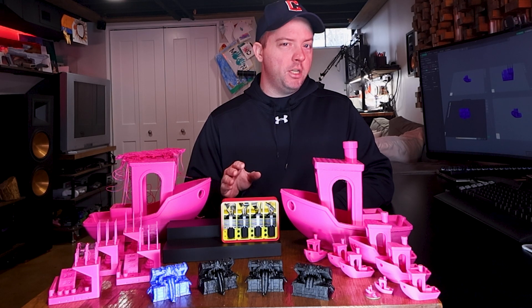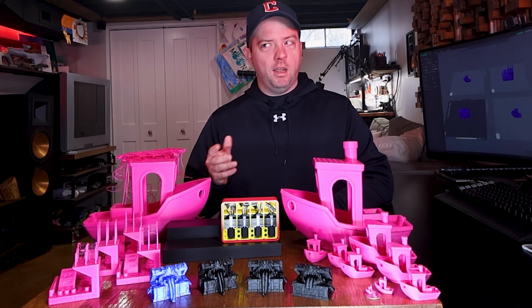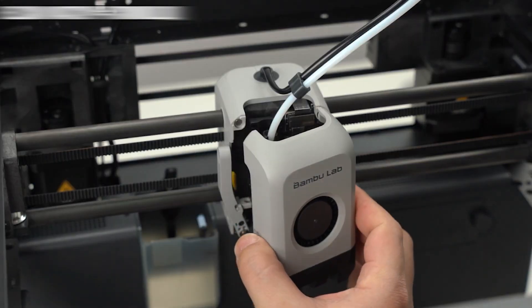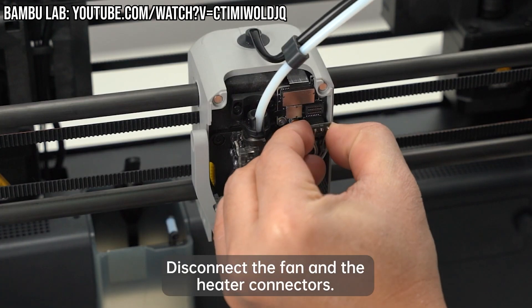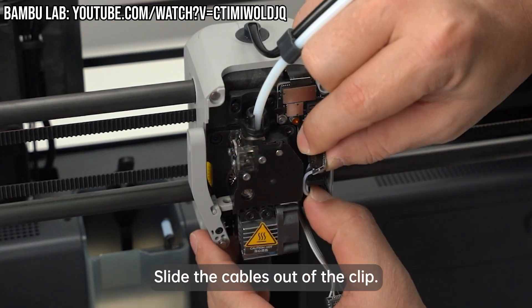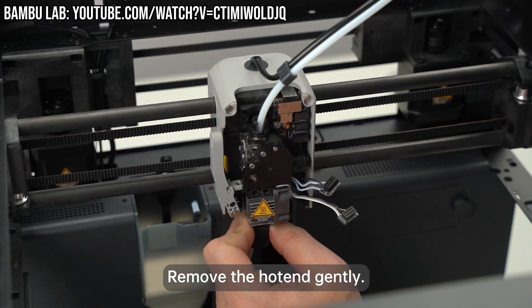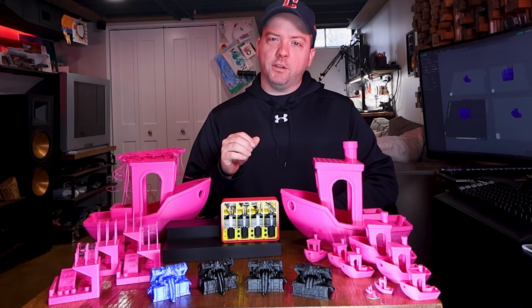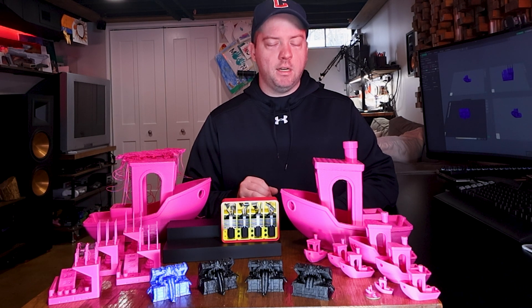I got awful footage of changing the nozzle on the P series, so I'm going to defer to the official Bambu video, which did this without the top cover — a good idea. Once again, heat the nozzle, retract the filament, and let it cool. The front fan cover is held on with magnets, so pull it off and carefully pull on the fan connection to completely remove it. Carefully remove the two remaining connections on the PCB. There are two screws requiring a small allen wrench holding the nozzle in place, then pull straight down to remove it. Reverse the process to install your new nozzle. If you don't seat the connections correctly, you'll get an error that the fan speed is abnormal because the nozzle fan connection wasn't fully seated.